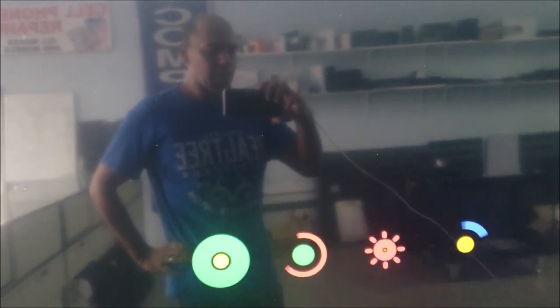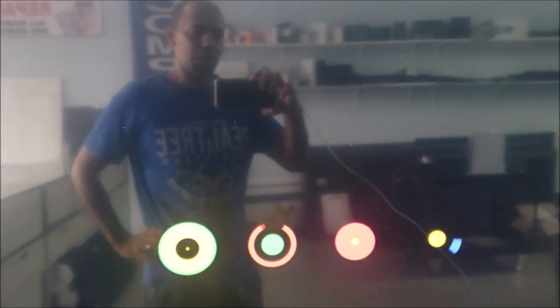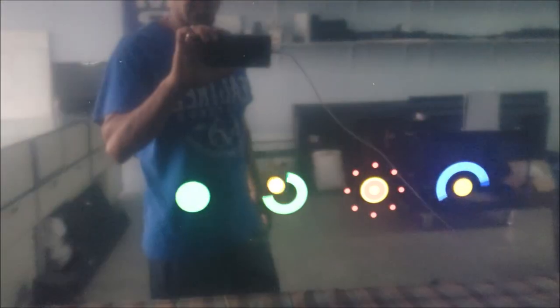If you install a different TV model firmware in the wrong TV, you may have a black screen, or you may have a screen resolution picture that's flipped, or even discoloring. So installing the right firmware matching your TV is very important. Yeah, now it's staying on longer. It's not like the 30 seconds restart and looping. So we wait till we see the home screen.